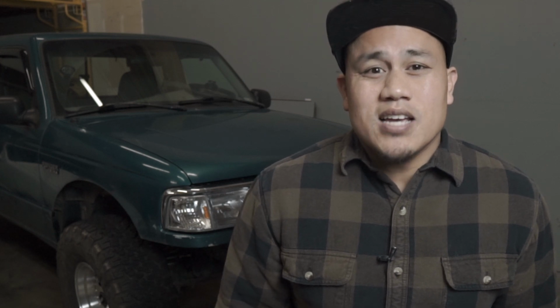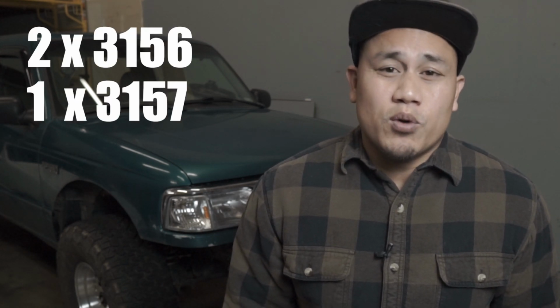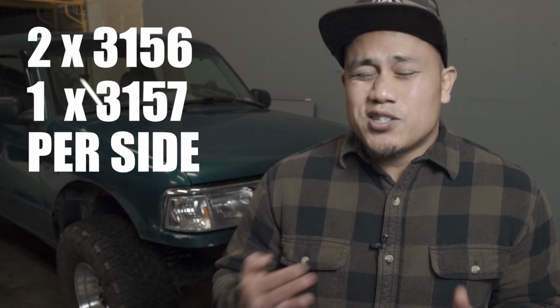And that's it, super easy DIY. For your convenience, I'm going to put Amazon links to the bulbs you need for this project in the video description. You'll need 2 3156 bulbs and 1 3157 bulb per side. So that's in total 4 3156 and 2 3157.